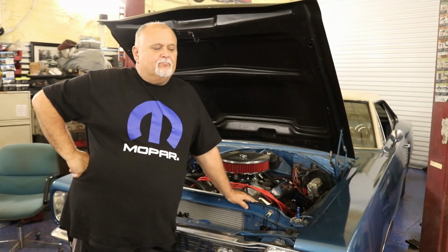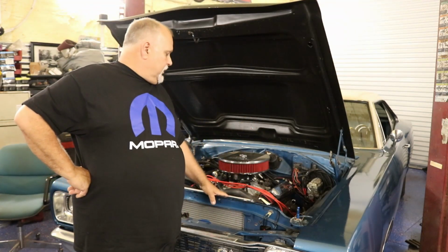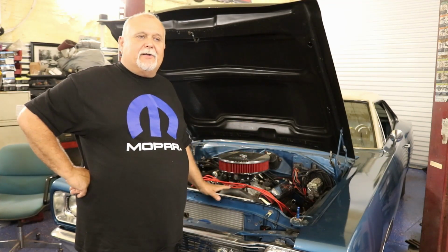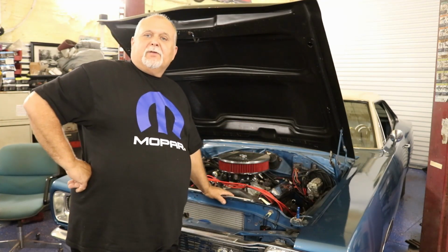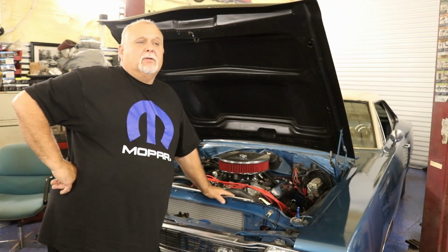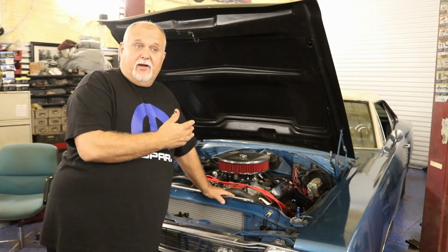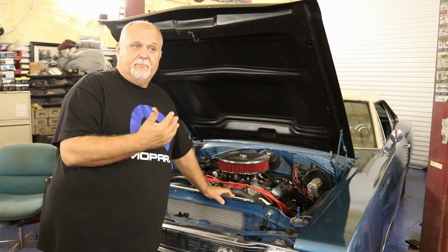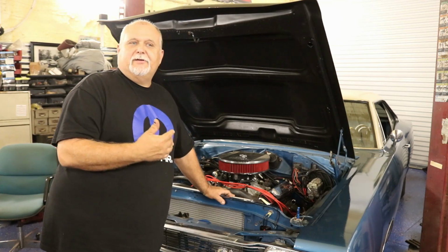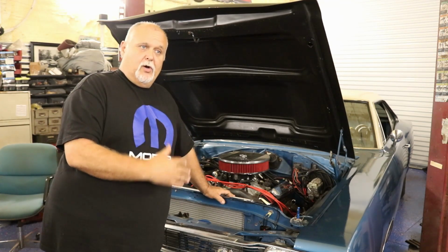All right, everybody, well, I got my nitrous on. I got a full bottle and got that last weekend, but when I got it all put on, it was raining. This weekend it's completely raining, so I really couldn't test it out. The bad problem is, in doing all this, I changed my rear gear and I also put a new O2 sensor on there because I've been running really rich and it's not been reading right. So I thought the O2 sensor was bad, so I put a new O2 sensor on it.